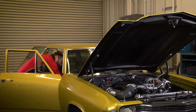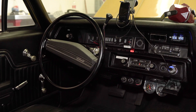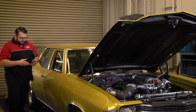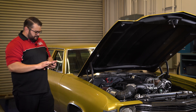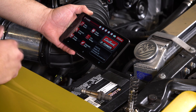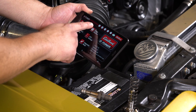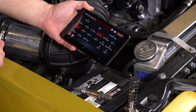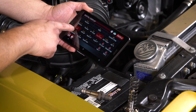I'm going to go ahead and turn on the ignition. Ignition is on. I'm going to turn on the tablet. On the tablet we're going to go ahead and get connected — tap the red X, now we've got a green check mark. We're going to go into gauge displays, digital display, and we're going to be watching this channel right here: AFR.